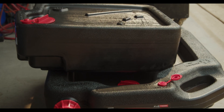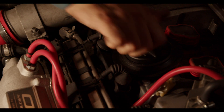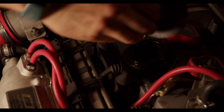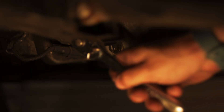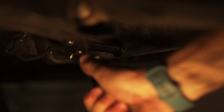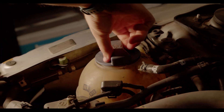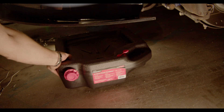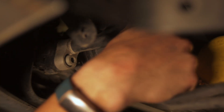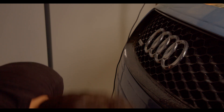Since the OEM turbo is cooled by both oil and coolant, we need to drain both of those systems, starting with the oil, which is an incredibly easy step but has a very high mess potential. And if you thought the oil was easy to drain, the coolant is somehow easier. Just like the oil, you unscrew the cap in the reservoir, and then you go under the car. This time, you're going to look on the driver's side of the radiator for a little nozzle with a knob on the end — turn it and it functions like a faucet, bringing us one step closer to the swap.